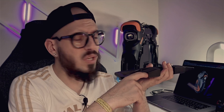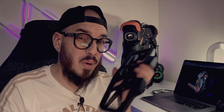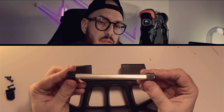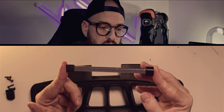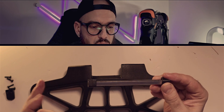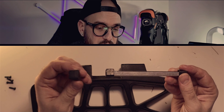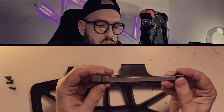One of the things that always irritated me with pedals is the fact that you always have a bit of a hole, and with time, water and dust will start to get stuck inside. When you need to use your tools to remove your pedal, it's quite tough. So Inmotion thought about it by putting two big pieces of rubber in both ends of your axle, which will stop dust from going in. On top of that you'll have another piece of metal, the same material as your pedals, covering that end.